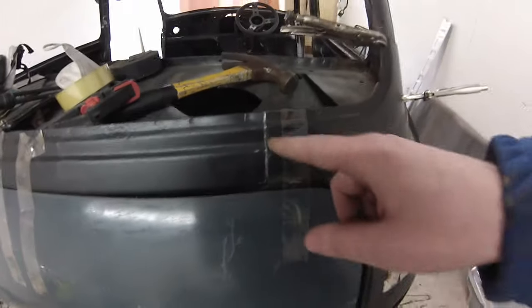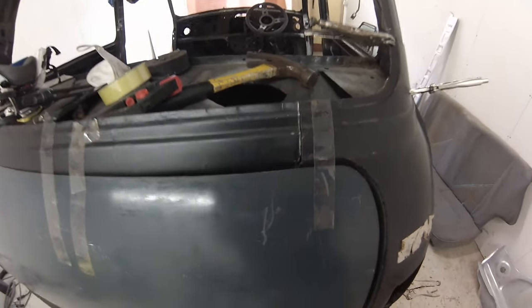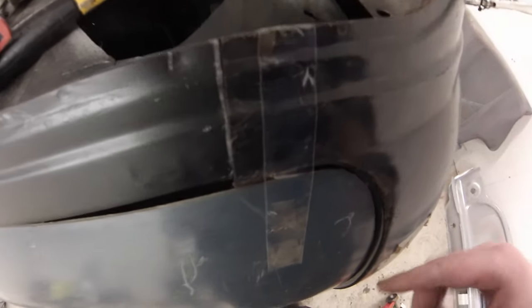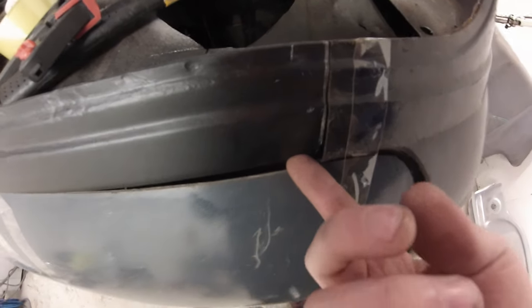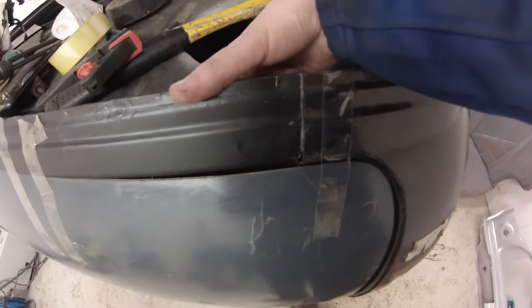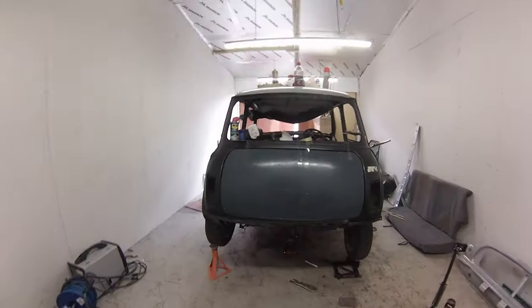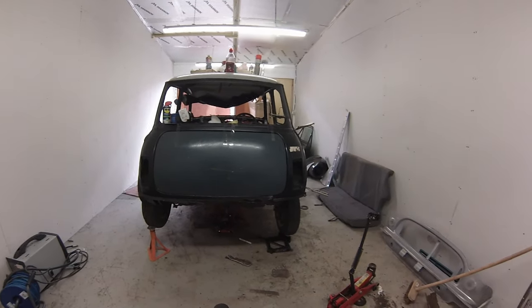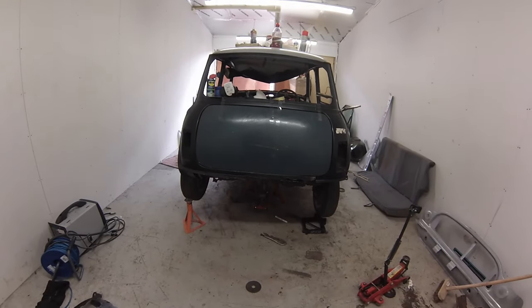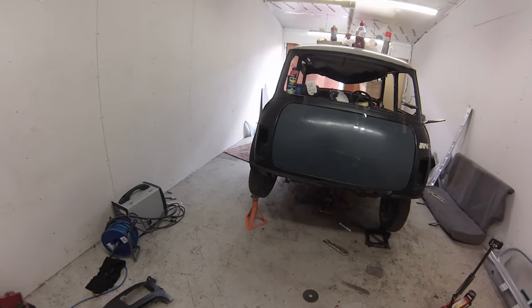The only hard part for me now is to get that bit right. The main thing is the weld — where I'm going to have the weld, it's not going to be too impossible hopefully. I just want to press that in. It's quite tight there, which is good. Obviously this is going to take some filling or whatever, but it's doable — I think I can do that. This panel is the one that needs to pull out, weirdly, because you can see there's a gap there. If I press that hard enough and then tack weld it all in place, it would hold. It's sounding a little bit more like a Mini now, at least at the back. Right — next idea: clean it up like I said, and then we'll look at cutting up the boot floor, or at least see what we can do with that.